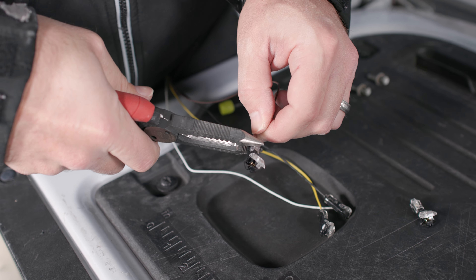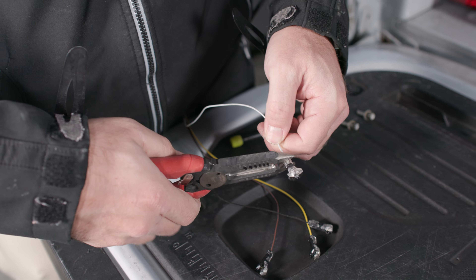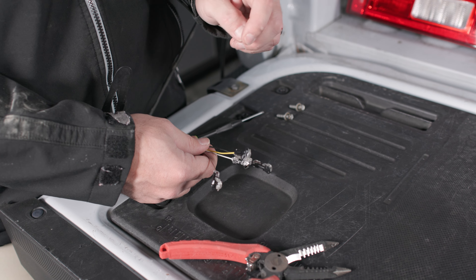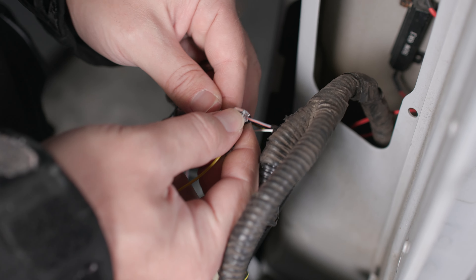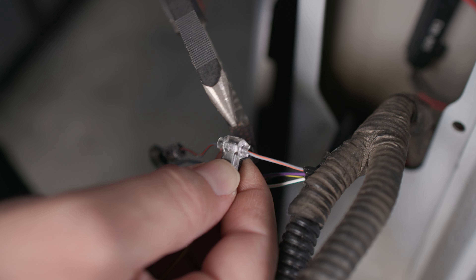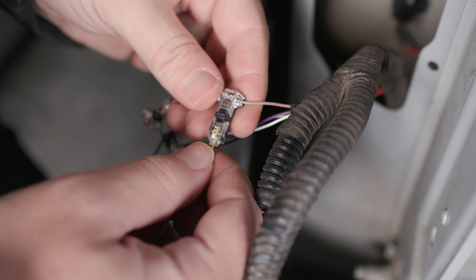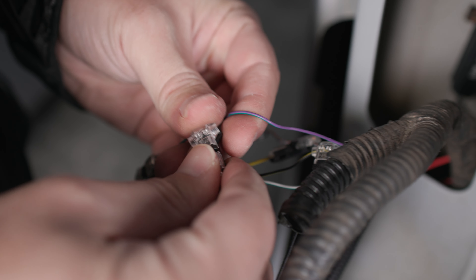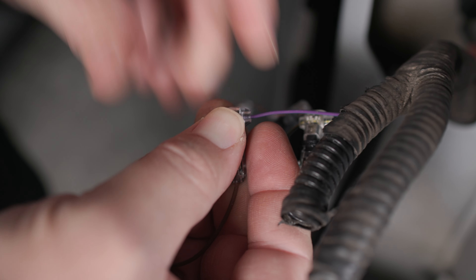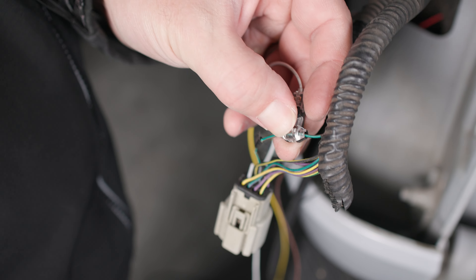You're going to need to consult the PDF guide — those instructions will tell you which wire colors to connect to depending on the year and trim level of your truck. We'll add a link to the wire PDF in the video description. The yellow wire, which acts as your driver turn signal, goes to the gray-orange wire on this particular truck. Black is the ground wire — on this truck we go to the black-yellow wire. Brown is our parking and running light, going to the violet-green on this truck. White, which is our reverse wire, goes to green and brown on this truck. You just put the long end over the wire and push down — you'll hear it click.